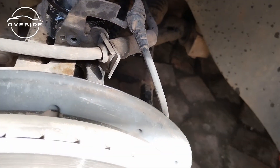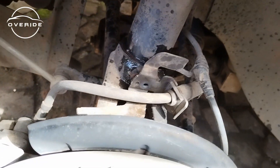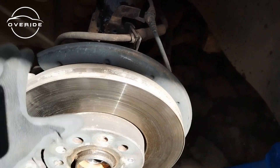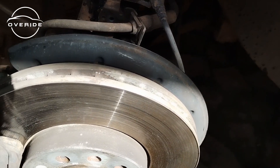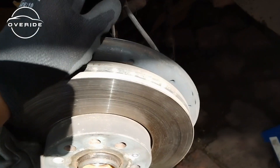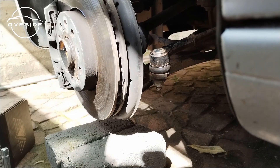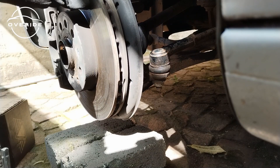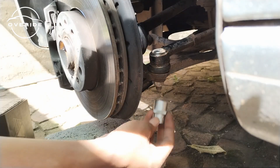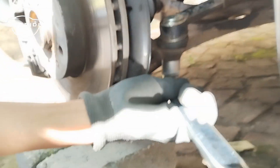I need to remove the drive shaft and secure it onto the body, then separate this big chunk from the drive shaft and the shock, then jack it up so it doesn't pull the brake lines or the ABS sensor. The next thing to remove is the tie rod so the steering knuckle can move freely. My tie rod end is held in by a 19 millimeter socket.